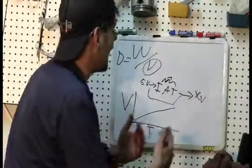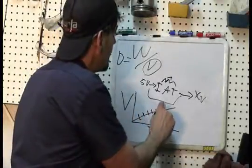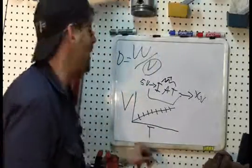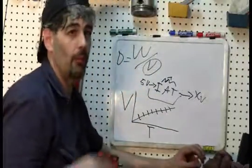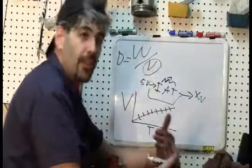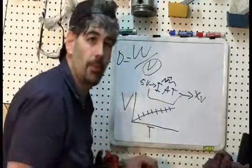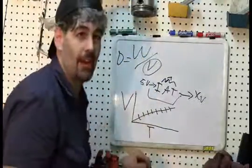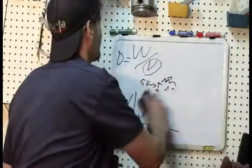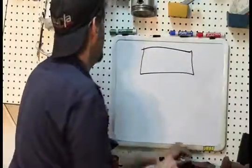And this is actually calibrated so that based on the voltage, the IAT knows what the temperature of the air is. And then there's another mathematical formula that will tell you the temperature of the air is going to have this much density. So therefore, because it knows the volume of air and it knows the weight of the air, it can now calculate the density. So that's what the IAT does. Now, the specifics on how it works is what we are going to have to investigate.